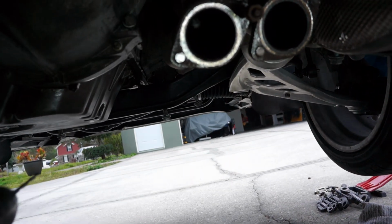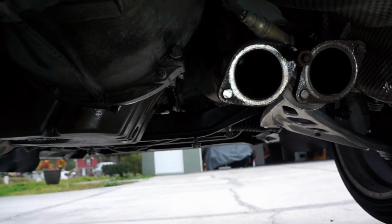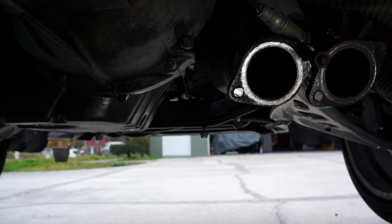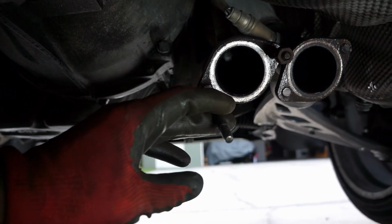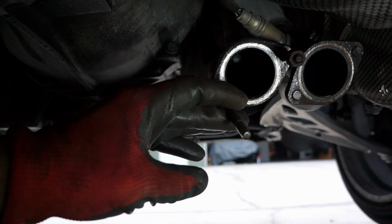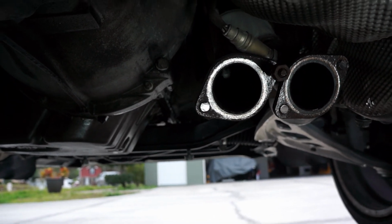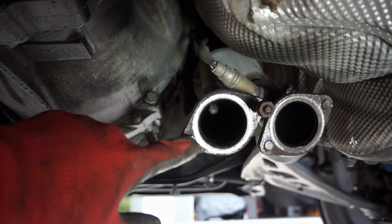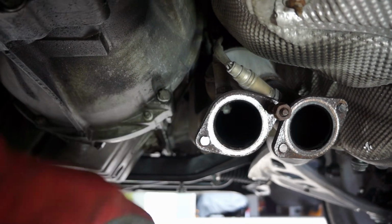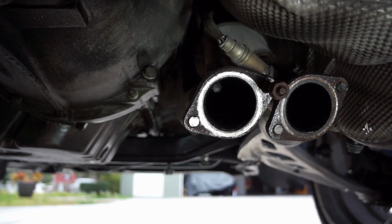through each of the studs to get them out. So in order to not have it slide, I'll use a center punch here, and I'll make sure I get close to the center, and then I'll drill right through it to be able to knock this out of its place. And then I'll put some bolts through here to hold it together when I'm putting it all back together.